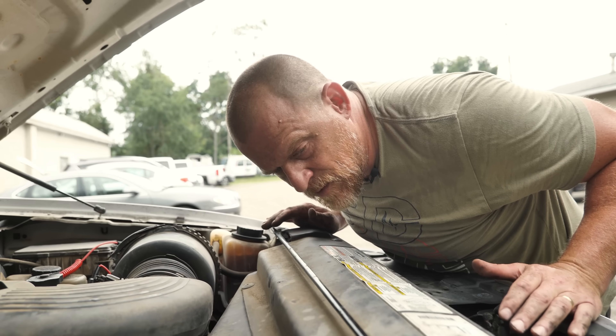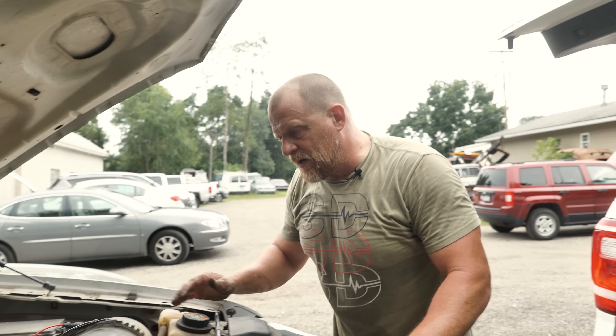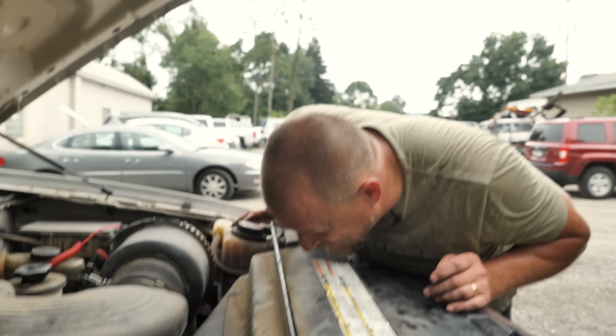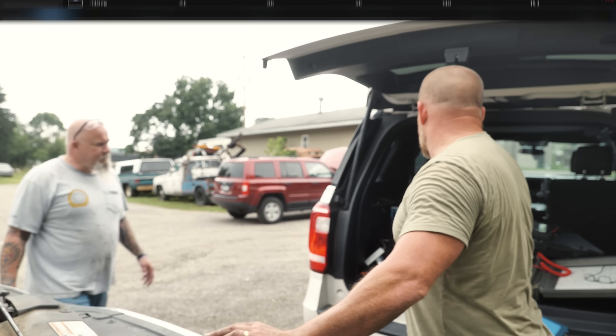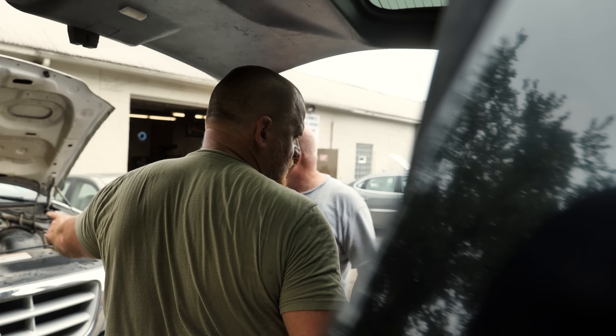So I'm going to make Pete do that. I'm not touching that. What we could do is swap plugs to different cylinders and watch it move. Maybe we do that just from a standpoint of let's get out of here. I do hear arcing too that I don't like. Absolutely — that is secondary arcing. I hear it. That's like a different cylinder though. Put your hands in there and move them around. Yo, it'll get me — that right there, that's number six. That's a bad spark plug.